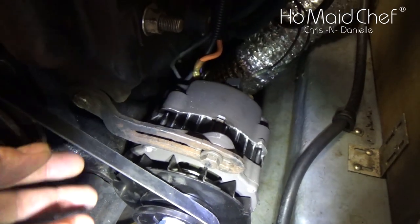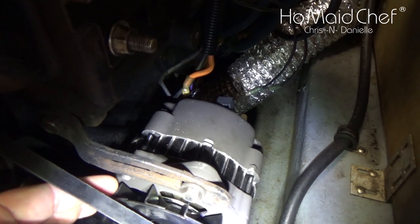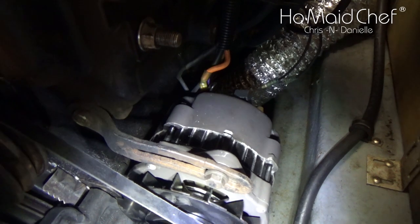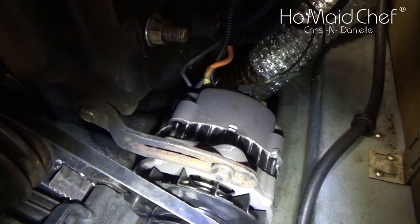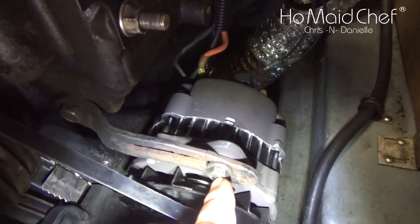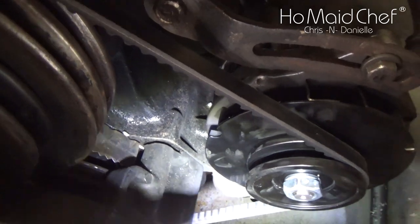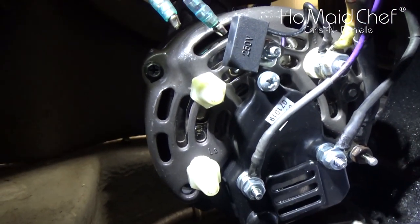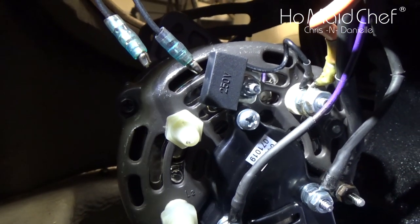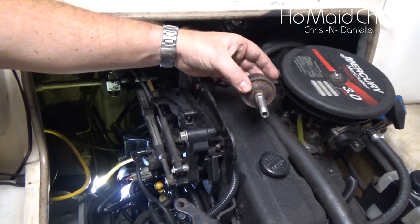As you can see, we have a brand new alternator installed. I've left an Amazon link below — this is a perfect fit for the Mercury 3 liter and it also fits some of the other ones. You have your bracket here, your bracket below right there, and then you have your four-point wiring below. Perfect fit. And now we're going to show where the oil pressure gauge goes.